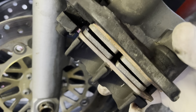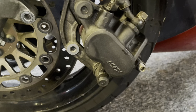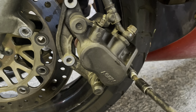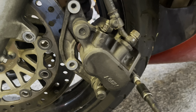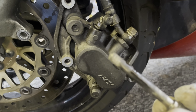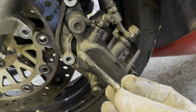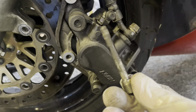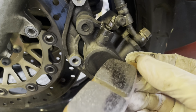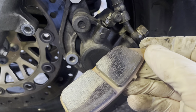You can see the pads there. Behind the pads you can see the pistons, and you can see how corroded they are. Pull that slide pin in and the pads drop out. That isn't really the cleanest it could be either, so we'll clean that up whilst we're on. You can see how the shine on the pads indicates that they've not been hitting the disc quite square.